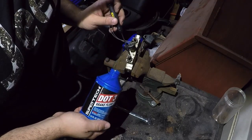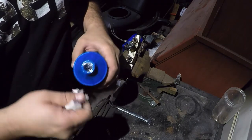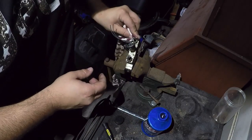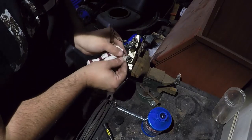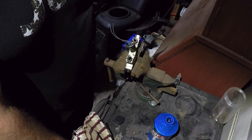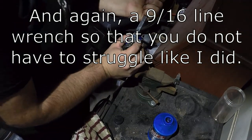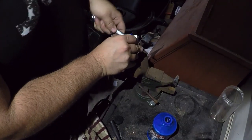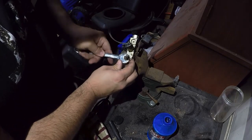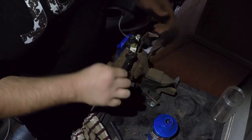That's what I got - a little rag. Let's see if that works. Now, I would suggest if you're doing this in your Jeep, actually on the car, get your line wrench. I'm just using my regular 14mm and I'm just going to try to get it broken loose. I'm only doing this to show you that you want to take it out of your car and do it properly to clean it. Also want to make note - that sensor you see here, be very careful with that.